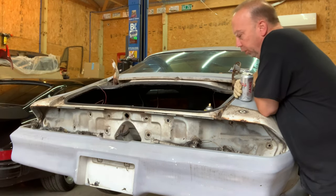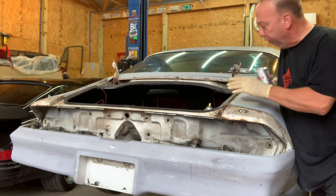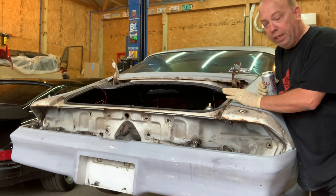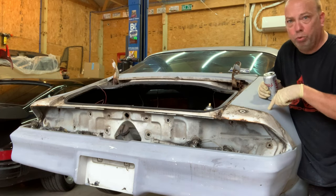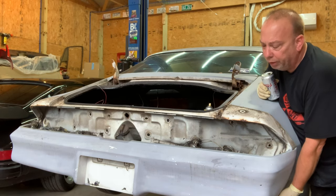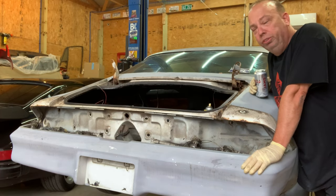All right guys, so now we're gonna tackle the bumper cover. After the spoilers are completely off, there is rust. I'm going to show you the rust. I'm going to vacuum everything up, a lot of dirt and stuff like that. There's little side trim pieces. There's two, I believe, 3/8 bolts on the inside. Flathead screw on the bottom. This doesn't feel like it has one. Nope, because it's flappy.